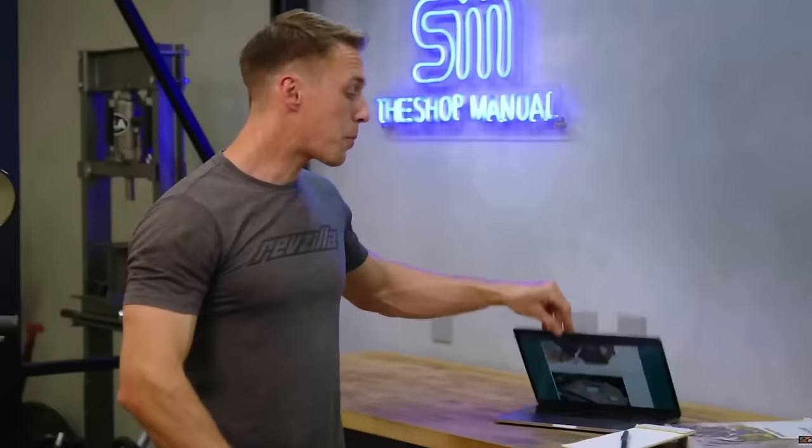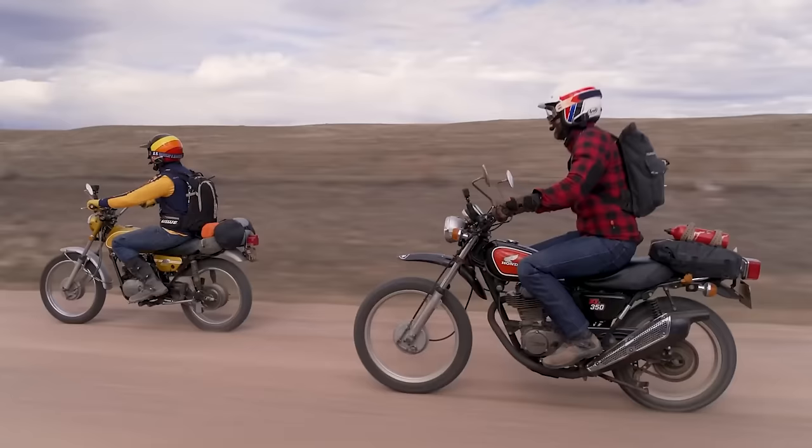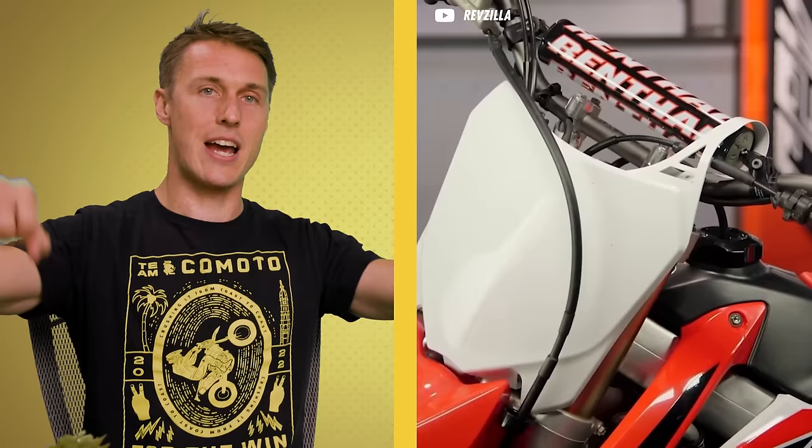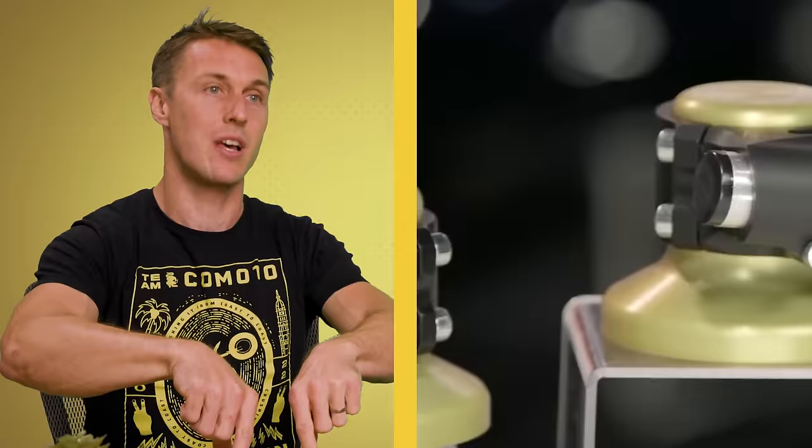My name is Aerie Henning. I'm a lifelong motorcyclist. I'm the host of The Shop Manual on the RevZilla channel, which is a maintenance and repair show, and I also co-host a show called CTXP with my buddy Zach — and he absolutely rips on a motorcycle. Typically everyone knows what a handlebar looks like — shape of a mustache, connected to the top triple tree with its bolts. The clip-ons actually connect to the fork tubes, which is why they call them clip-ons. They position the rider lower, in a more hunched position, so they're more common on sport bikes.